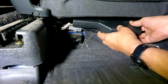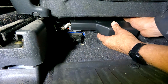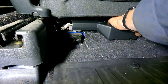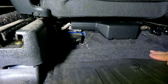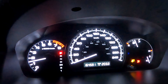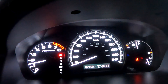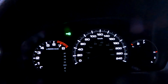I can feel the front tab hook in place, then press the other tabs down, and everything is back where it should be. Start the car up and the new sensor should clear that code and the engine light. I cleared the code, the engine light is off — I'll do a test drive in a few days to make sure everything's good. No more engine light; new O2 sensor installed.